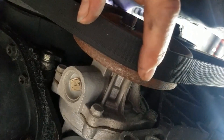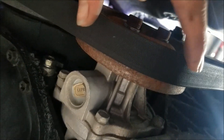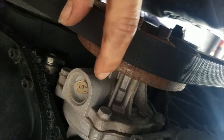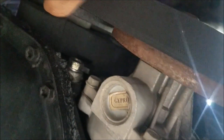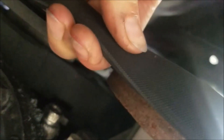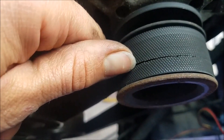Here you can see my water pump, but this is not the 2-liter water pump pulley — this is a water pump pulley from a VR6, which is why the belt that I'm using actually doesn't ride the whole way over. This is supposed to be a smooth pulley, but you can see that the smooth side of the belt is facing outward and the ribbed side is facing on the inside of the smooth pulley. Just over time I get cracks forming in between the ridges on that belt.